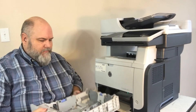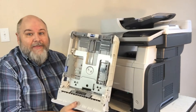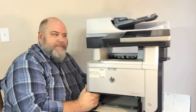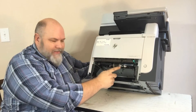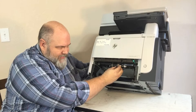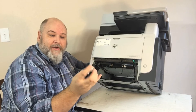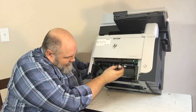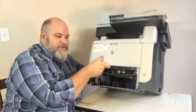Tray two is also a familiar design. It's got two screws right down here — the whole separation pad comes out and you replace the whole pad. That one's very simple. On the tray two roller, it's got the roller with round rubber cams on each side. It's spring loaded, so all you have to do is push to the left and rotate out — it comes out just like that. If this comes apart, there's a spring inside and the parts will go flying, so be careful — putting it back together can be quite challenging. Push it back in, find the hole, rotate until it clips into place. Tray two is done.